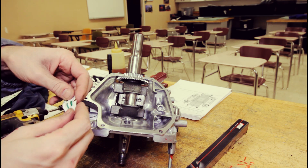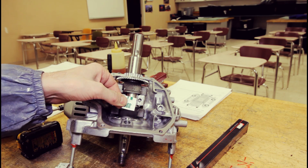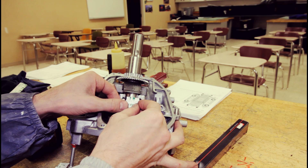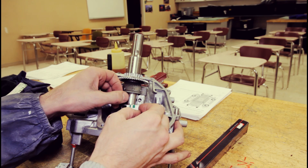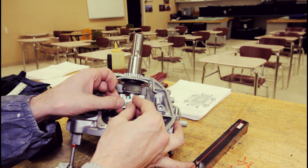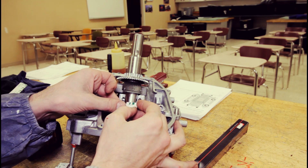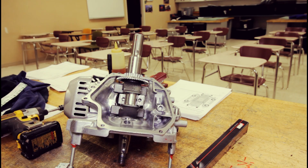I'm going to tear off the metric side. You compare how wide the smear is — it looks to be about a thousandth and a half. You can see it's got a little bit of taper in it, which is another good thing this does: it shows you if surfaces are flat. I'm at about a thousandth of an inch at the top — 0.001 — and it tapers out at the bottom to about a thousandth and a half. I just compare it to the service manual spec, and this one's good.